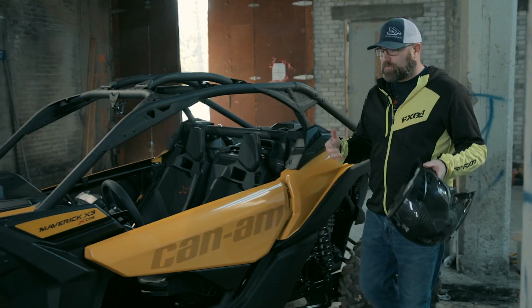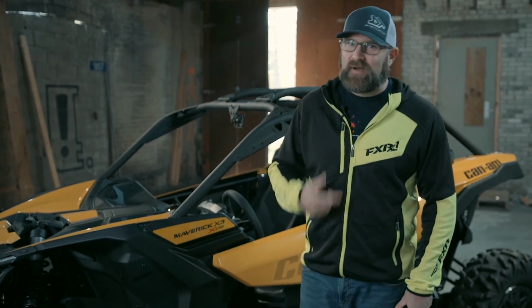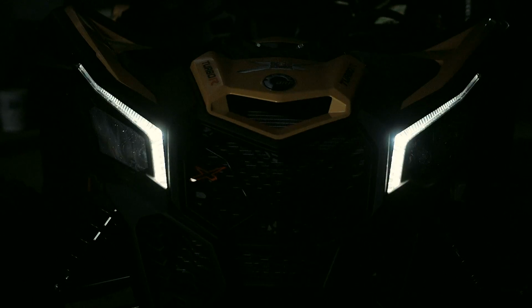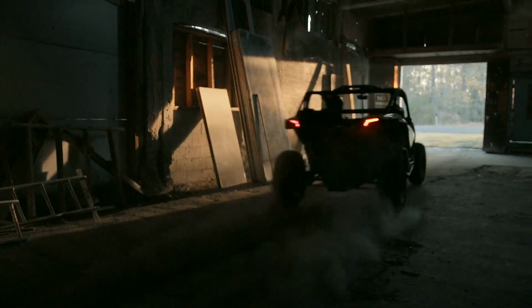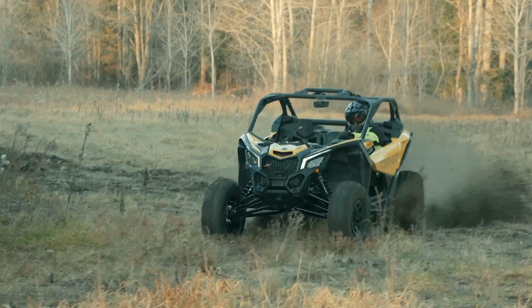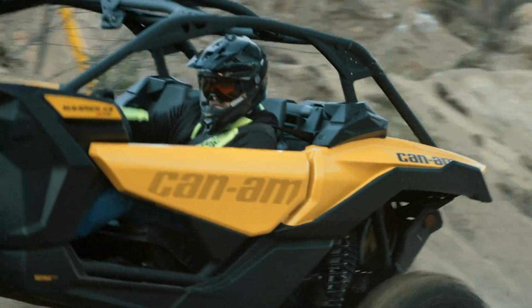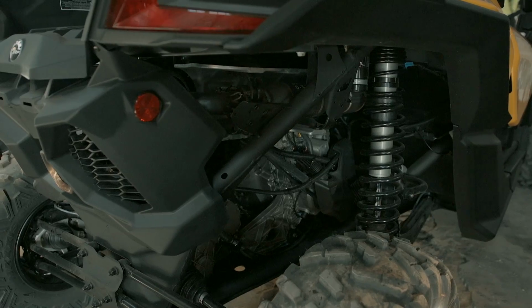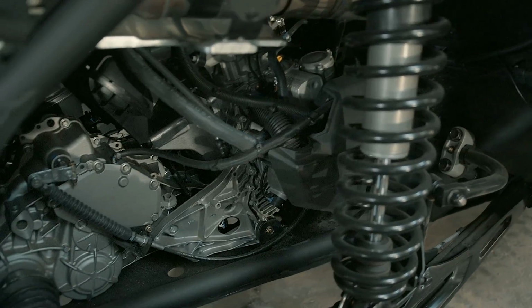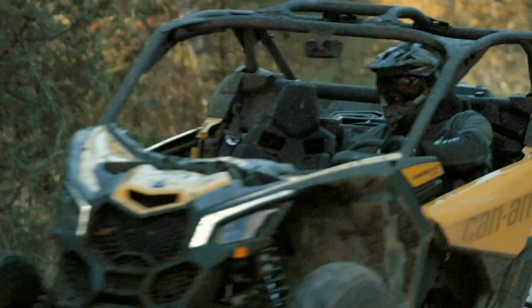When I was a kid, turbos weren't really a thing. The old adage, "there's no replacement for displacement," conjured up images of big-bore, high-cylinder count engines in my fantasy vehicles. This is the decade of the turbo, though. And while a turbo can make anything better, a turbocharged 3-cylinder engine is just a special combination. The X3's 900cc turbocharged and intercooled engine is referred to as the ACE and produces 154 horsepower with next to no turbo lag, thanks to the turbo being part of the exhaust manifold.